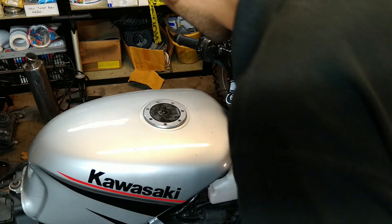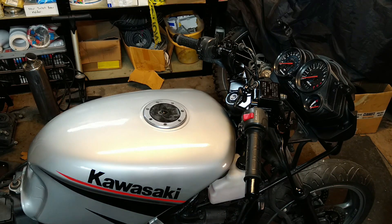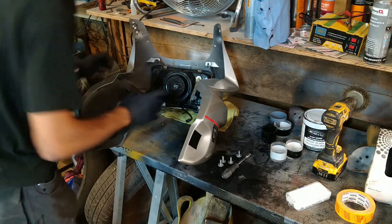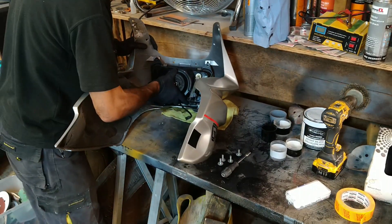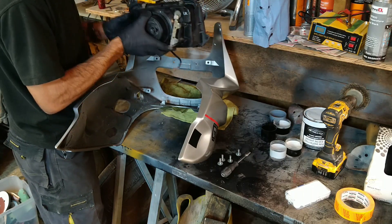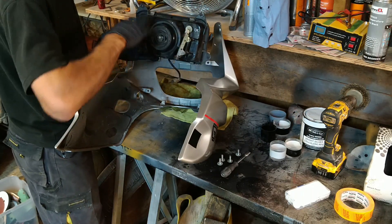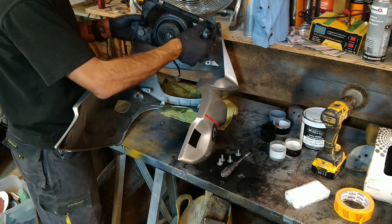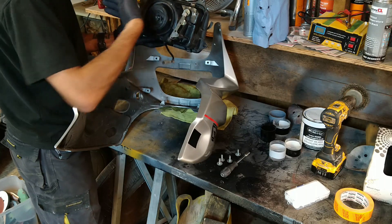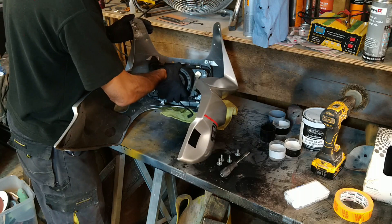Okay, fuel cap back done. Now we can set up our rig for our front fairing. Okay guys, we're at the point of getting our headlights into our front fairing. That's our headlight — four bolts. This is the adjuster for the internal light for up and down, your angle of attack on your light, and then on the left-hand side you've got an adjuster for centering.